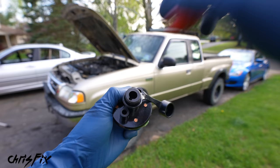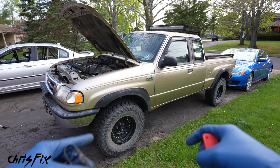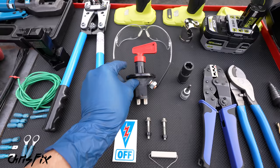And finally, if your car doesn't have a theft deterrent device, one way you could add one is with a kill switch. So when you leave the car, you take the kill switch out like that and now the car can't be started because there's no power. Now I do want you to remember, anytime you shut the kill switch off, you are taking battery power away from the computer, away from your radio. So you're going to reset all those things, so just keep that in mind.